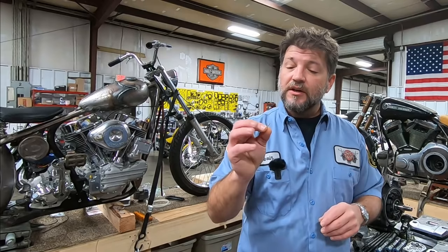Let's take a look at the size of the terminals inside your ECM — they are incredibly small. When Harley moved the ECM to the top of the battery, that almost created the need to disconnect the ECM when you change a battery. I would not recommend doing that. Instead, lay a cloth on the side of the bike to protect it from scratches and lift the ECM up without disconnecting it, because these terminals are only designed to be disconnected and reconnected a handful of times. Repeatedly doing so can stretch the terminals and create connection problems.